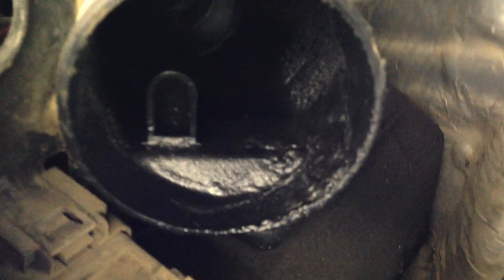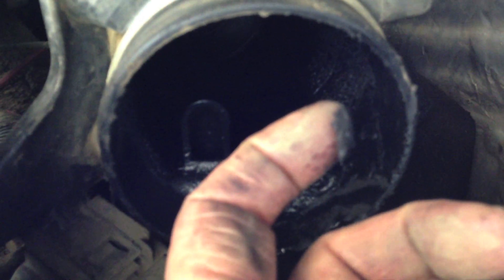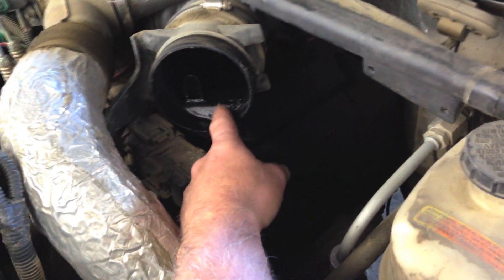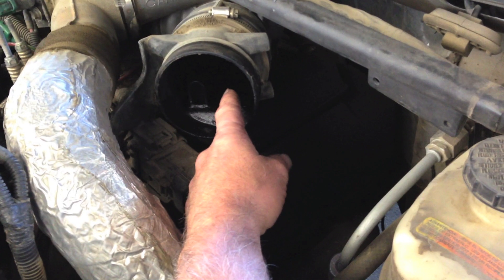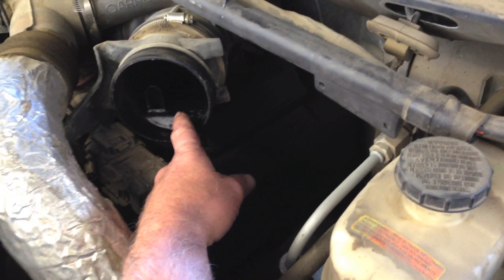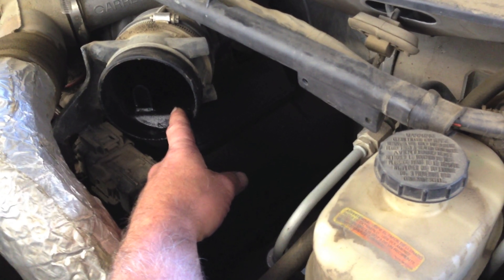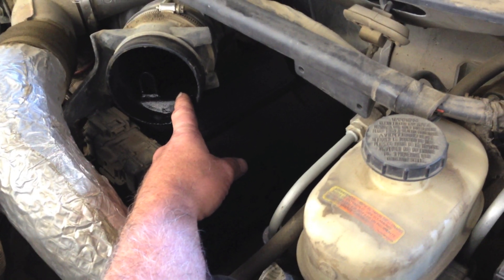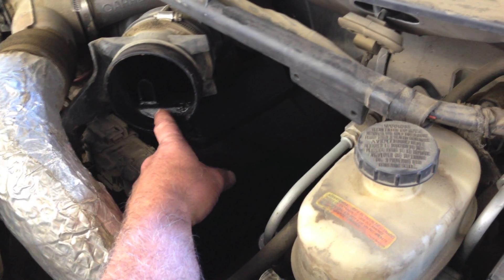You can see here there's no sealing along there. Look at the turbo—look at all the dirt inside of here, it's all just going through the motor. Look at the turbo blades and see how much they're worn. The same abrasive dirt that went through the turbo causes it to wear and also wears the cylinder walls out. That's why we check the crank before we do any work or try to sell the customer injectors, because it's really hard to collect thousands of dollars for injectors and then have to tell them their engine's bad.